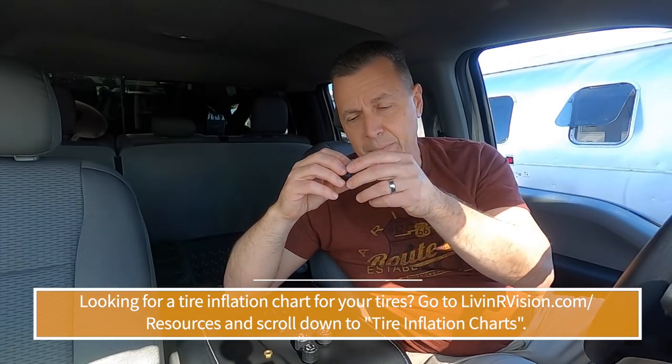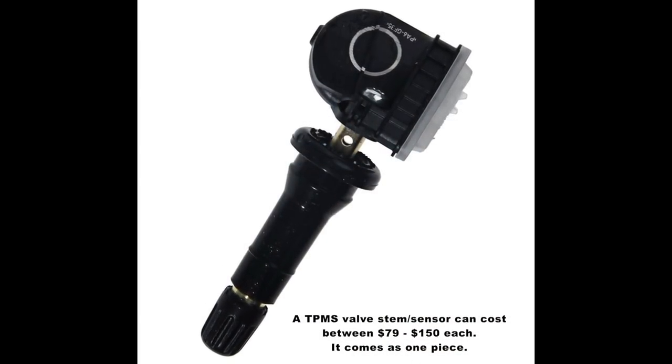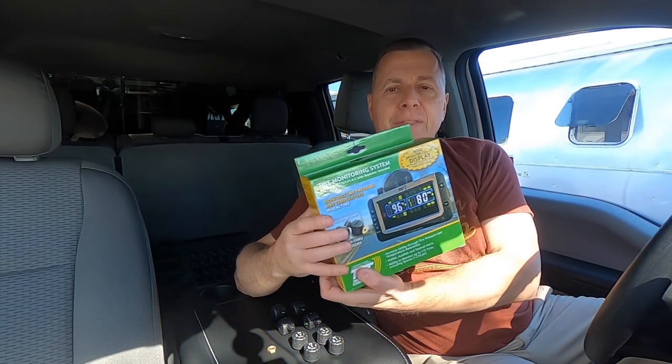If you want quick access to put air in your tires or let air out, it's much easier with the cap sensors — you use your wrench to back that lock nut off and then take them off. Why didn't we put metal valve stems on the truck? Because the truck is equipped with its own tire pressure monitoring system. Those valve stems on a truck tire have the TPMS built into the back of the valve stem, so if you're going to change those out and put metal valve stems on, you'd have to change your TPMS sensor too.